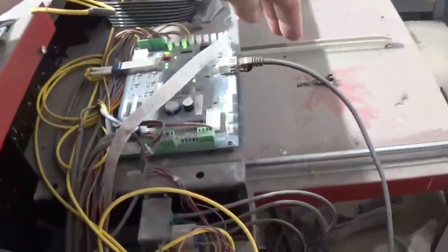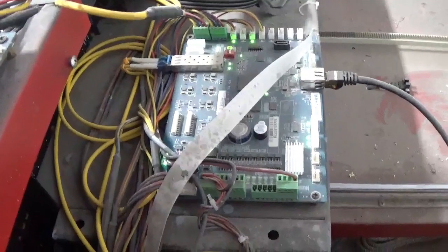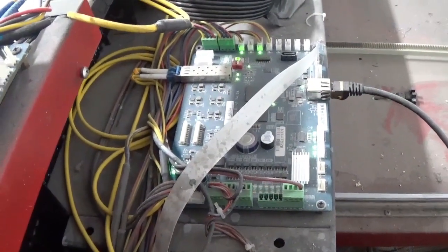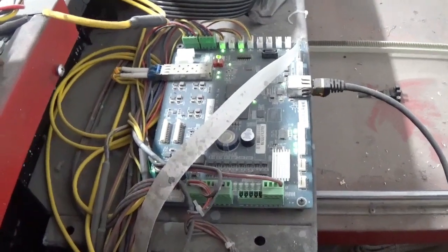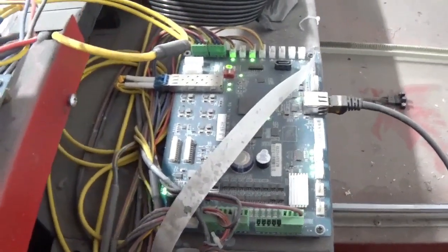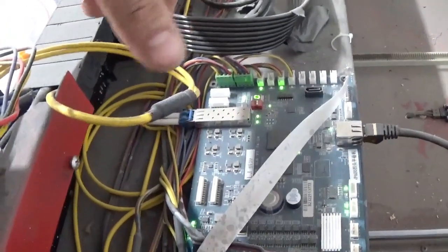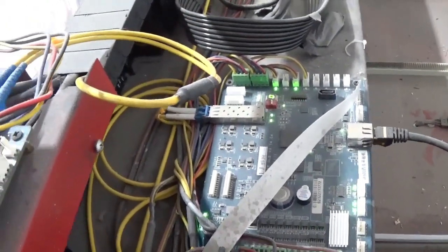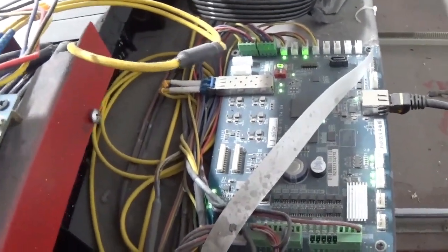It hooks up here to the motherboard. So this is your main board — this is what tells it to flash. It's pumping when to turn on and off the ink stirrers if you have them, and sends signals to the print heads. This is basically your main computer board. The fiber wire coming off of this — yours might have flat cables, it's just a different motherboard — but the fiber wire and the ribbon cable do the same thing.